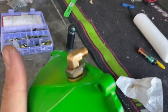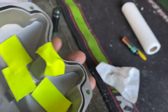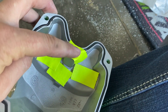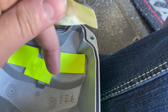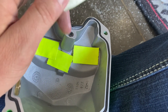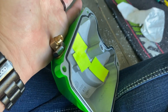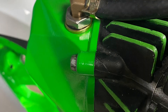I got it installed — see, it doesn't take up much room in there at all. I also cleaned this out and taped over the holes because oil enters this hole from the motor and comes out these little sprayers here. I didn't want any metal shavings getting in, so I wanted to be able to spray in here and wipe it out clean afterwards. Should be good to go — if for some reason it acts funny I'll update the video and add something at the end.